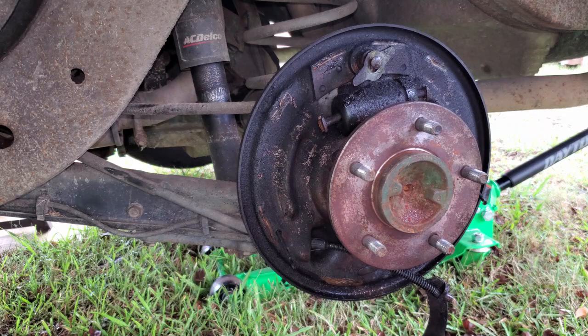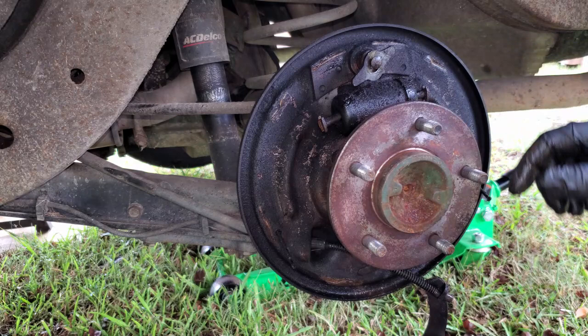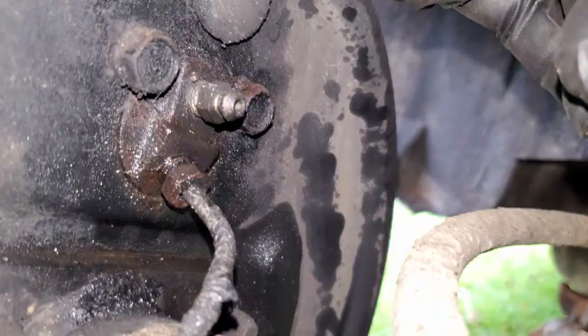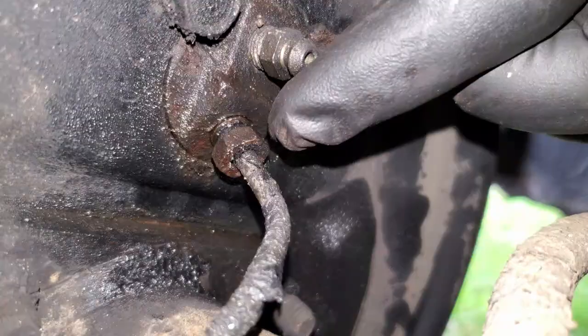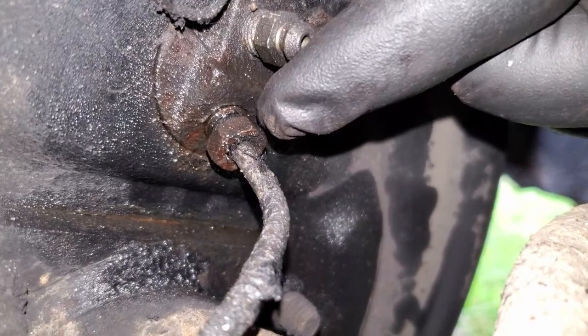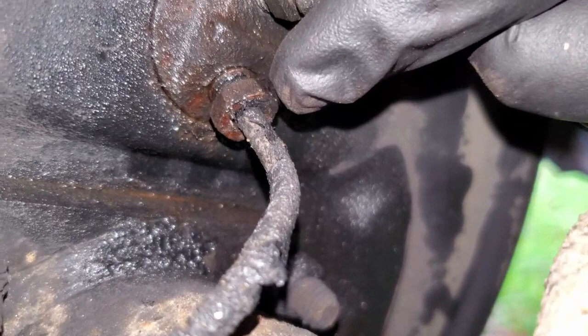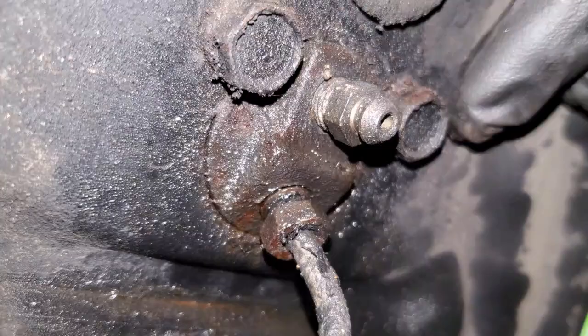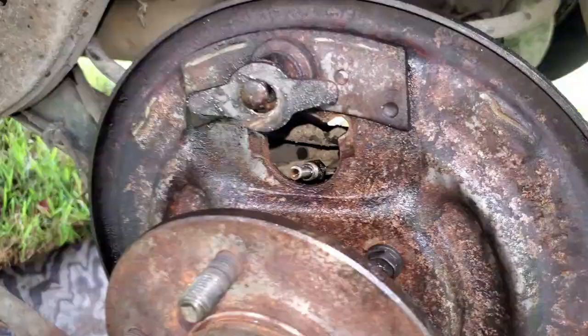It is best if you're doing this in grass to put a pan or a board or something under it so everything doesn't fall in the grass and get lost forever. We've got it stripped down. I'm gonna go ahead and pull my wheel cylinder and put a new wheel cylinder on there, then spray it all down and clean it up. On the back side of the backing plate that right there is 11 millimeter - that's your brake line. It's best to use a line wrench, although most times I've had to use a vice grip because the line wrench will still strip them out even if you got a good one. Always best to try that first. Those right there hold your wheel cylinder on - they're half inch.